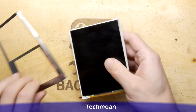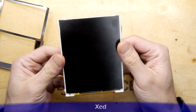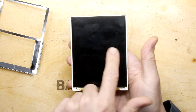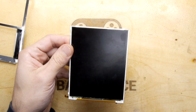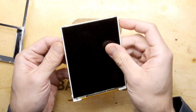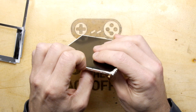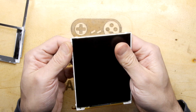When you see it inside the Nintendo, it genuinely is a regular TFT screen. What I hadn't figured out was whether the parts you can't see can be driven through this connector. My gut feeling is it probably can — whoever makes the screen probably just added it in — but if it's totally custom, maybe they did it a certain way. It's clearly glass because there's a smash here, which is why we changed it in the first place.